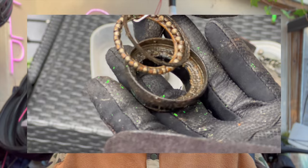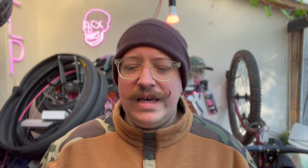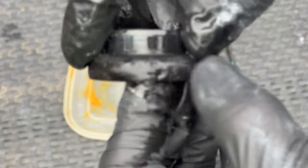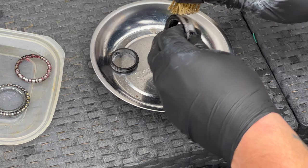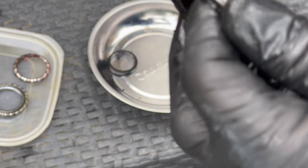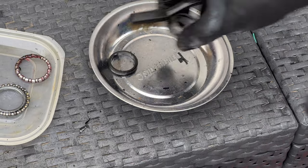In the spirit of trying to save money and make this as cheap as possible, the headset that was on this bike — the bearings inside looked pretty good. It was dirty as hell and needed a lot of cleaning, but they were fine. The actual cups on the outside were kind of rusty and a little bit chipped. I chucked them in some Wurth rust remover for about 24 hours. The Wurth seems to have got underneath the paint, and as soon as I got it out the paint just came off. So I hit it with a wire brush and scrubbed off basically everything that was loose — if it wasn't loose I just left it. It's still solid, so it'll be fine.